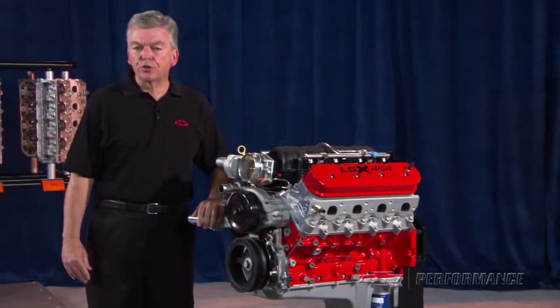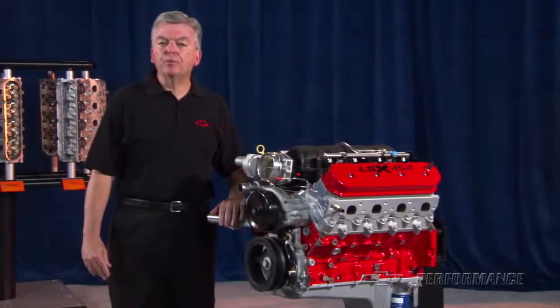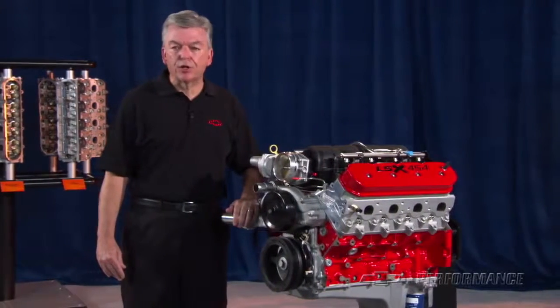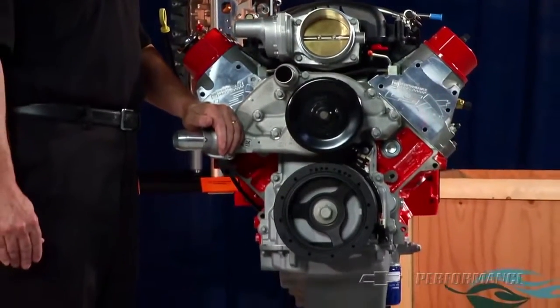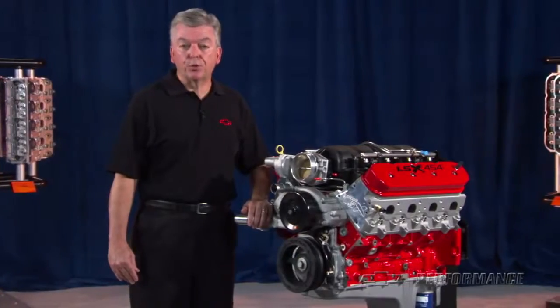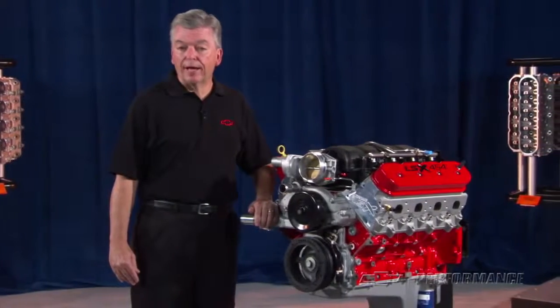too high for supercharger or turbocharger installation. Adding additional boost to this engine will most likely result in catastrophic engine damage. If you want to build a big inch boosted engine, you will have to replace the pistons with a lower compression ratio or build your own assembly from scratch.